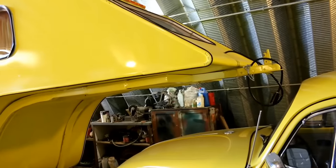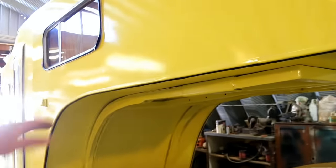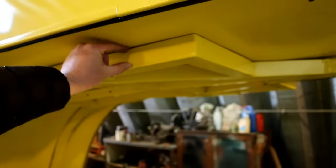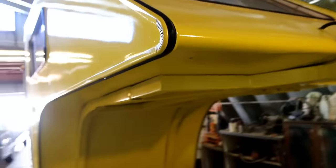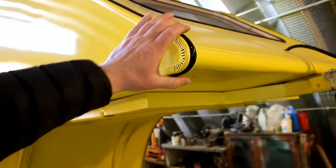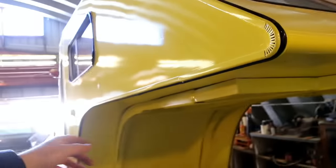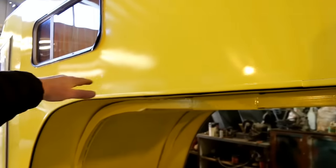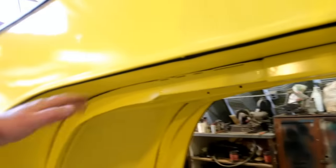One thing on our original trailer — if you'll notice here, this trailer actually has added structure, and this was done before Bob got it. Bob did make a few changes to tighten up the spacing and got the actual geometry of the trailer right. The trailer we picked up was really weak up here in the overshot, the gooseneck. You could almost lift up on this section of the trailer and the body itself wouldn't move. This whole area is laminated wood, and this reinforced frame basically just helps to shore everything up.